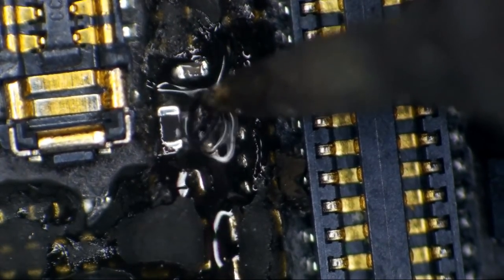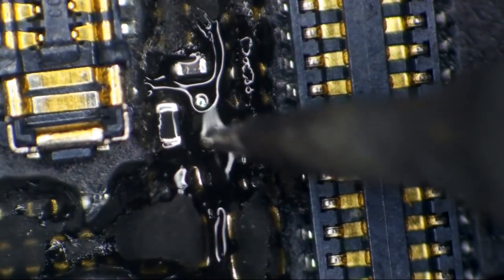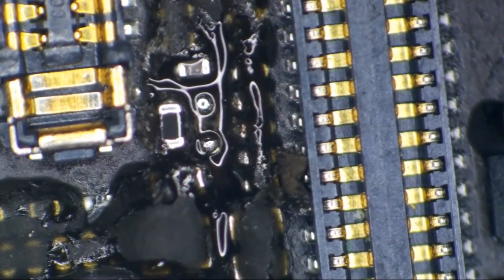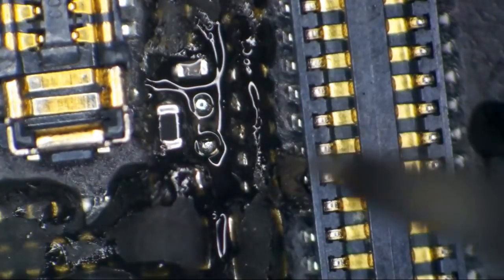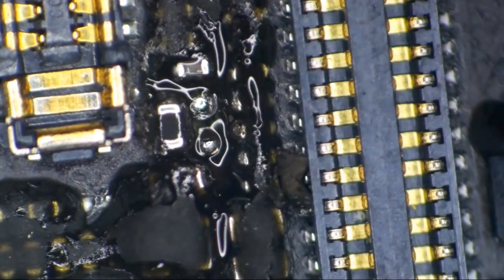All right, this side's probably okay. Yeah, that's not looking too bad. We got us a nice pad left on that side. This side over here, we don't have a nice pad. We got this ugly hard welded blob thing, and if I sit here and nitpick and try to get that off of the board, I will wind up damaging the board to the point where I'll have to pull the CPU shield and run a jumper all the way to BFE to get backlight working.